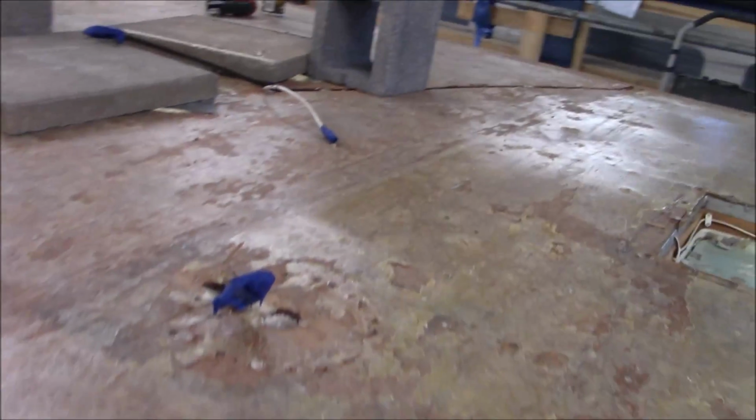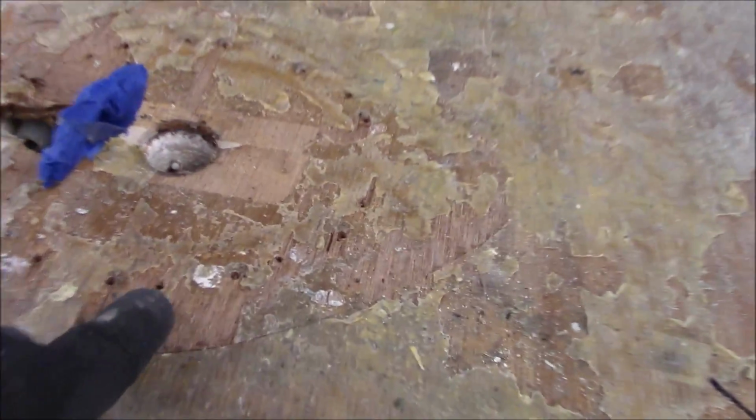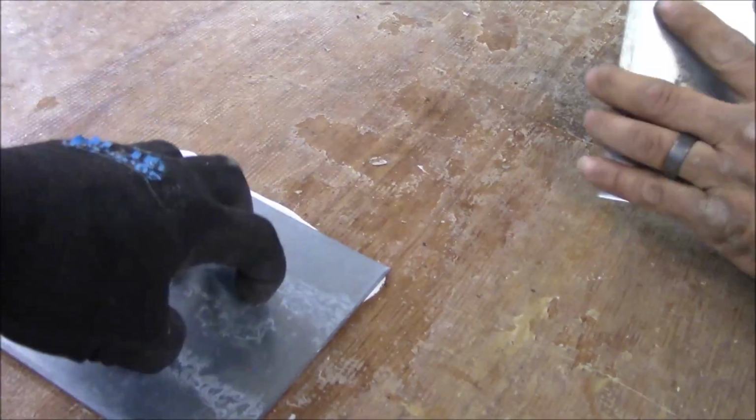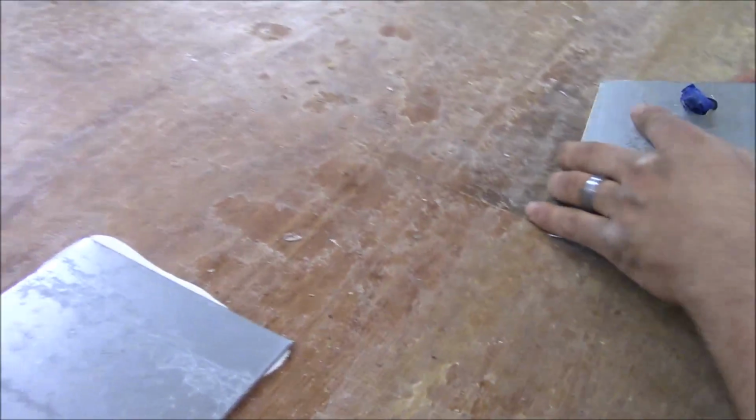So get all that. That's what we're doing right now, prepping the roof so we can redeck. You look at the way they put these in. This is the antenna they had, and all they did was just put it through this. This is just thin. It's not going to be enough to hold all that. So what we did is put these plates down, because we're going to be putting a different one on, and now the other decking will go over it, and then we'll have something nice, solid stock that's 16 gauge. We'll be able to get in there.